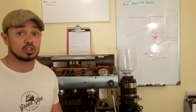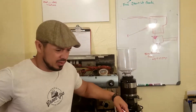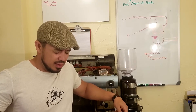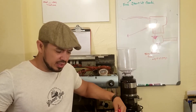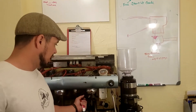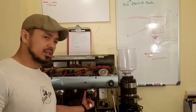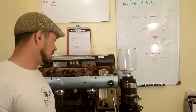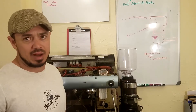If you've ever touched one of these things, you know they're hot as hell. They come in a couple of different styles — they can get fancy. The E61 is the big brass one. They also have one called saturated and then semi-saturated. There are just different methodologies for heating this big piece of metal and ensuring the portafilter stays hot. The reason they do that is so you don't have to flush the entire system every time you want to draw a shot just to make all this metal hot. Otherwise you'd be taking hot water from the boiler and putting it into a cold metal — and you're not going to have an accurate temperature doing that.